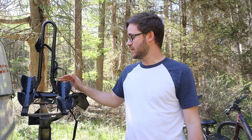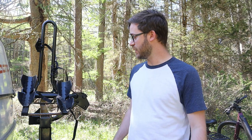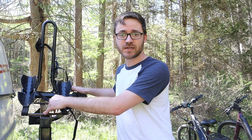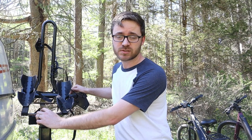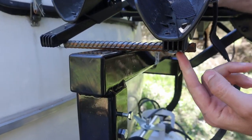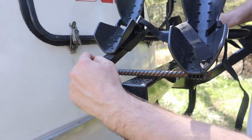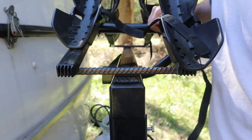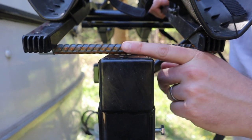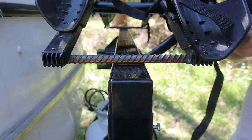This has been a bit of a work in progress. As we drive with it, we find little things to tweak. The latest issue was too much wobble, so I wanted three points of contact to keep the bike stable. I went to Lowe's, bought some rebar — a 12-inch stick cut in half — strapped it in place, and riveted it in by drilling holes all the way through and punching a rivet through. Next I want to add some stick-on rubber to keep the metal from rubbing together.